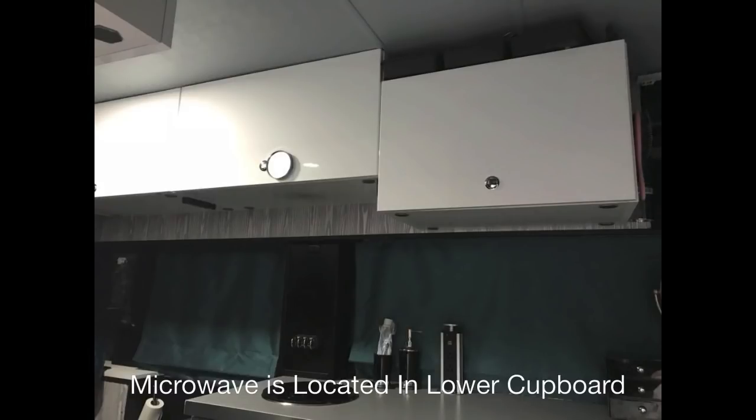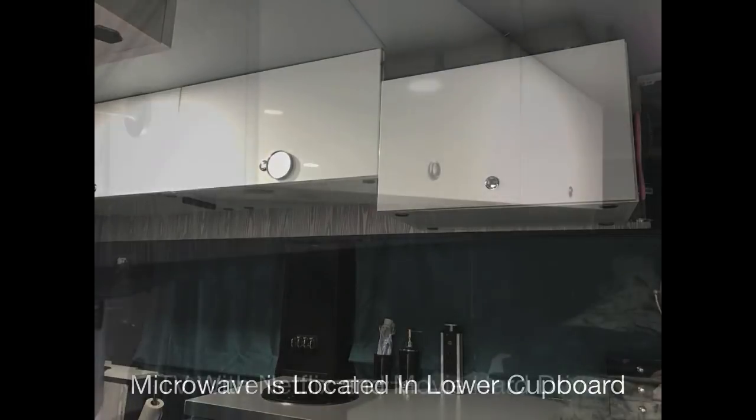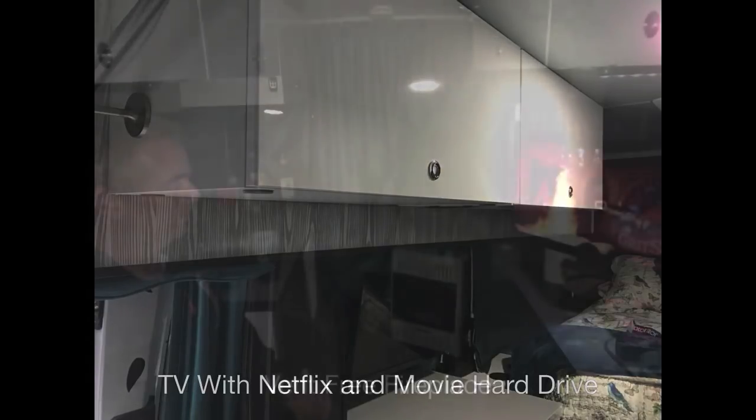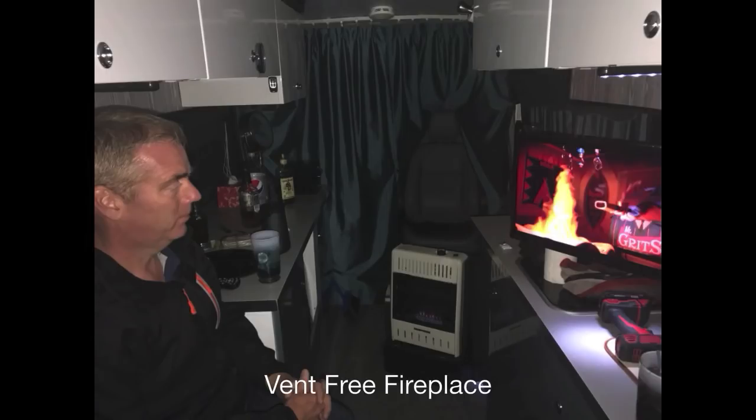There's the microwave in the lower cupboard — I think it's 700 watts. That runs off the inverter. We can go indefinitely because all you have to do is start up the engine if your batteries are getting low. I put in a welding cable from the alternator right back to the batteries. I have three batteries in this thing right now — I might even change that because they're 12 volts right now, and I might go with two 6-volt batteries instead.